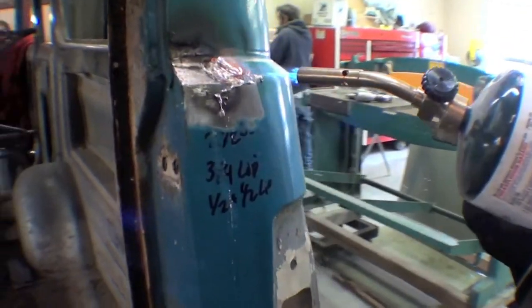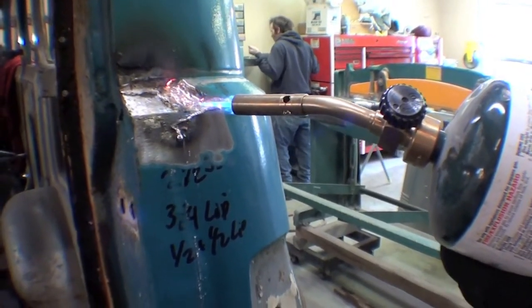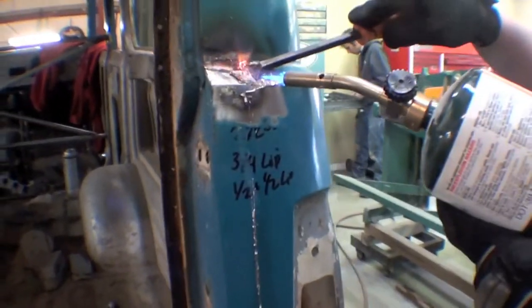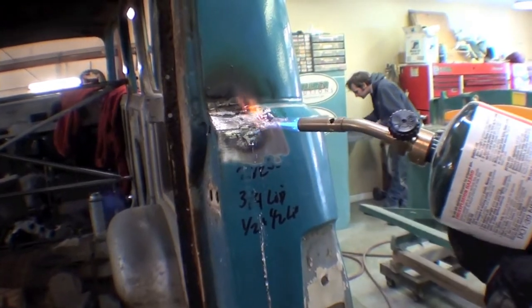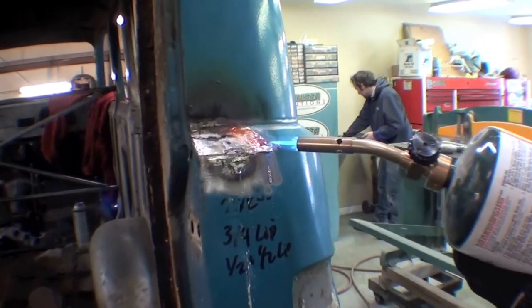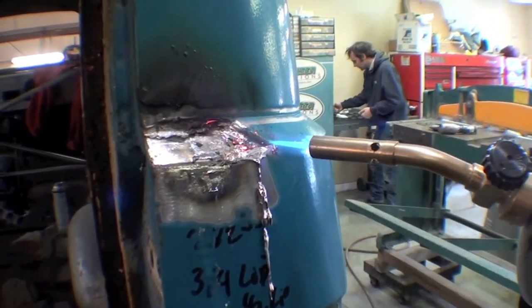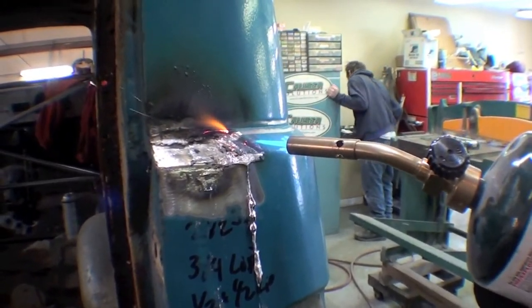We noticed it's all filled with lead. As you can see, we got Barry with the mini torch out, trying to shave that down a bit so we can actually see what's going on under there. It may be a factory thing like that, but regardless, we're going to get it scraped off and do a little metal work to make things fit better. As you can see, the lead is just melting right out of it — funny, we didn't expect to see that, but typical old repair, or this old coach-built stuff was built like this.